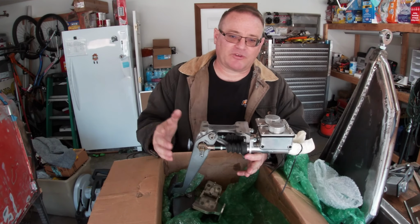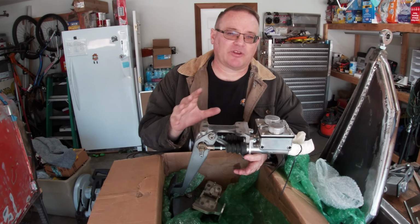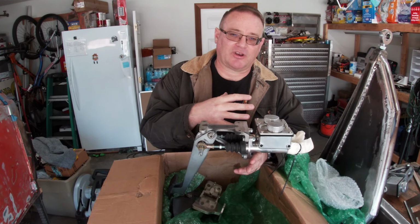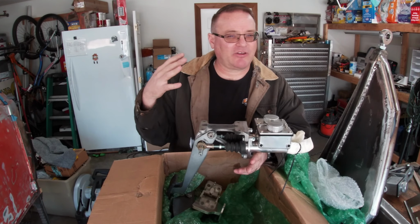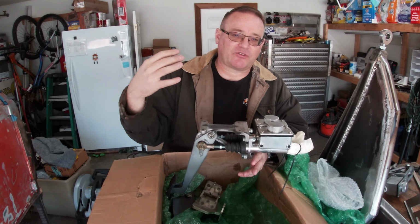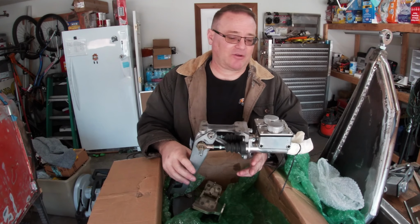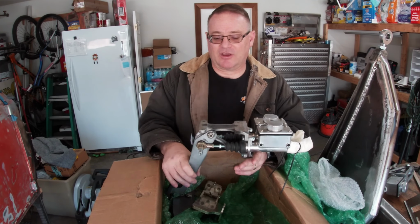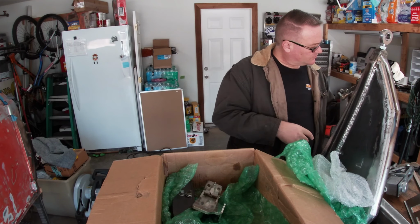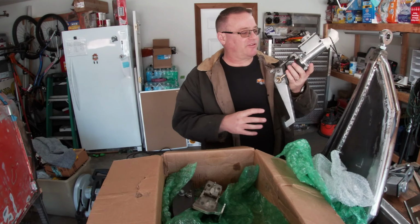Of course, I've got 4-piston calipers going to everything, but chances are I'll probably be limiting the front brakes, which is really odd. In the 4-wheel drive world, most of your braking is done in the front and not so much in the back. But because the weight bias, this is what I'm told, on our bug is displaced towards the back, technically you want your bigger brakes on the back, which is why I went with 4-piston calipers. So I've got some CNC brakes. Nice, 7/8. Oh, they're both 7/8, so they're both the exact same. Good enough.